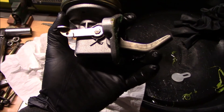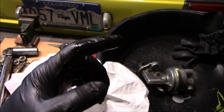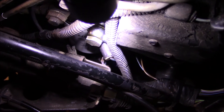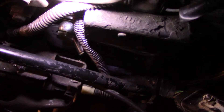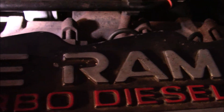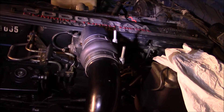The old lift pump's priming mechanism is kind of annoying — you press down on a lever, but unless it's on the bigger end of the fuel pump lobe on the camshaft, pressing down does nothing. With the new pump's accordion primer, you can just press on it a few times no matter where it is and then see fuel spurt out. I'll tighten that down to 18 foot-pounds, then loosen the injectors three at a time, crank it a few times to make sure I get fuel to the injectors, and hopefully take it for a test drive.